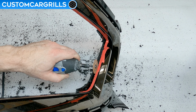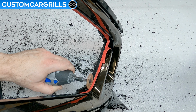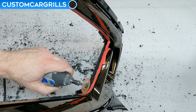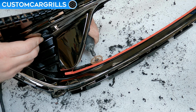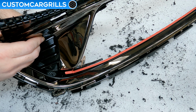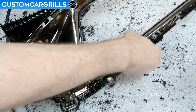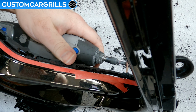For the sides, I'm starting near the top corner and working my way down. The starting area was near the point where the cutting wheel would be touching the top edge. Since the top edge was stopped a little bit short, I'll now go back and cut a little bit closer to the edge, but again stopping before the wheel touches the edge. And then cut off the sections for the top and side edges like this.